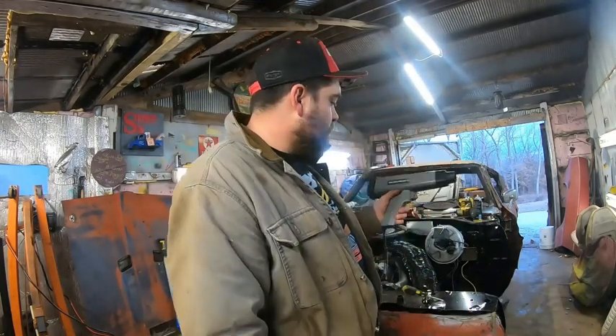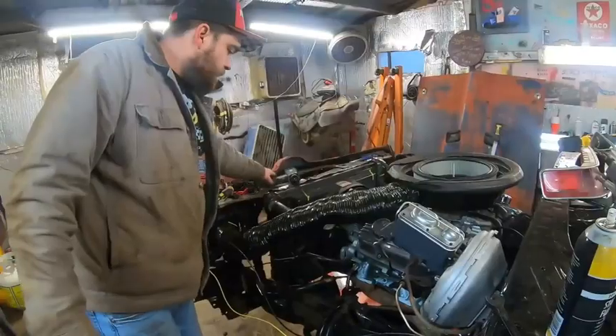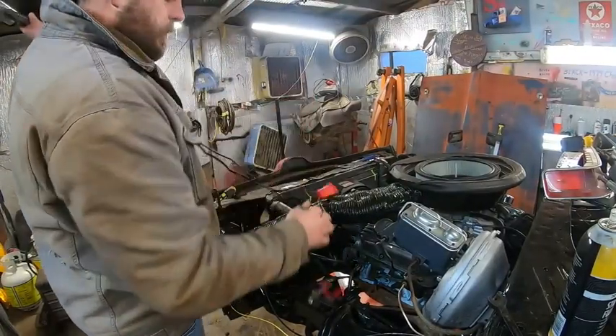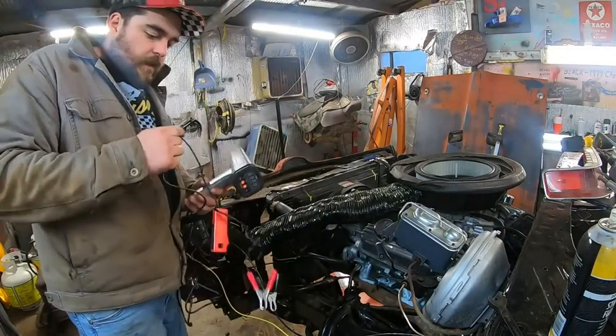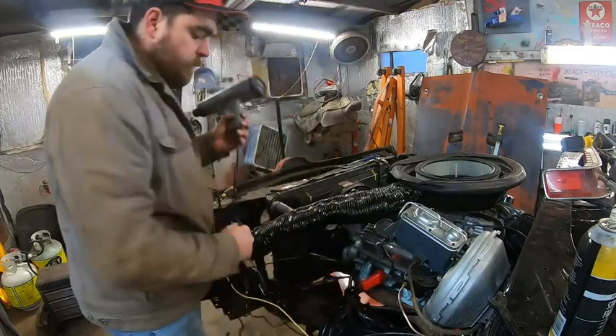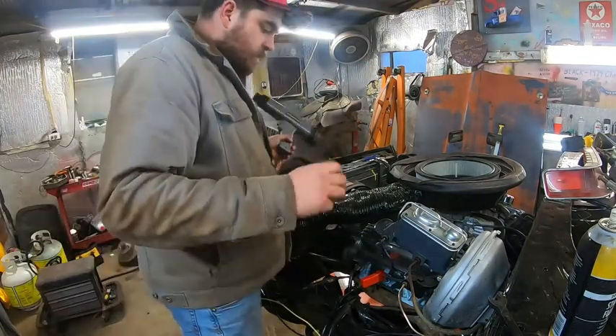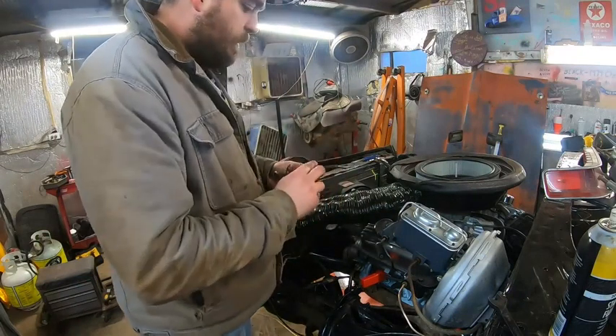Let's see how simple it is to work, if it's just like any old timing light or if there's anything special about it. Hooking up an induction timing light uses this clamp to sense the current passing through the plug wire. You put it on the number one plug, just because that's what everything is referenced from. Then you've got to ground it and get power to it.